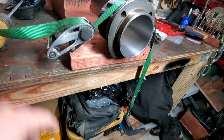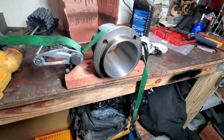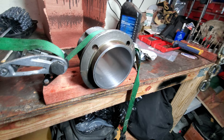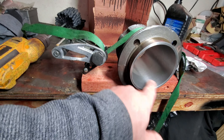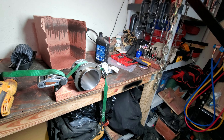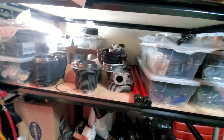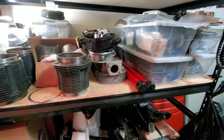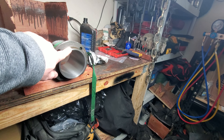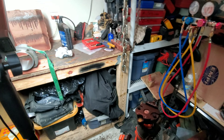This is my little jig I made up to hold this — it's just a 2x4 with a cargo strap and a couple screws holding it into the bench to keep the cylinders from moving on me. Because this isn't like a long block where the cylinders are just all sitting there easy — I need something to hold these VW cylinders in place. That crosshatch turned out great, fantastic. After I get these done, I've got to clean them up really good, spray them down with some degreaser or carb cleaner, then take them upstairs and wash them out really good.